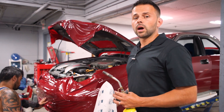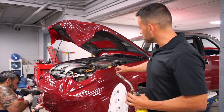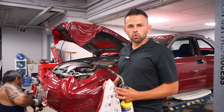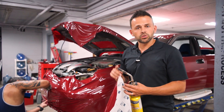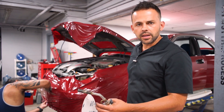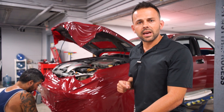To do it properly you don't want to apply with all the lights on and all the moldings on. You always want to make sure you do a full disassembly on everything needed — the handles, the belt moldings, the headlights, the fender liner. The more you tuck the vinyl, the less chance you're going to have of redoing anything.